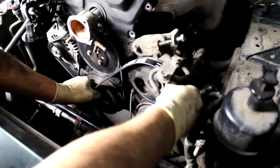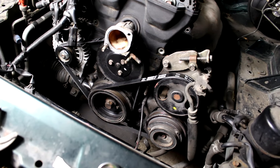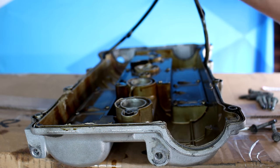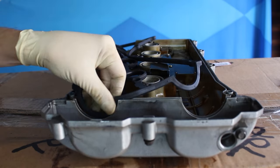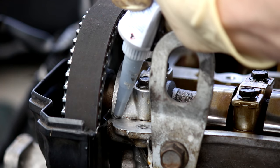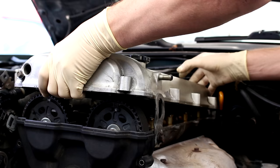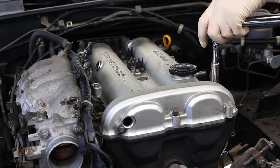Put your power steering belt on and reassemble that tensioner in reverse order. Look at this thing coming together — the whole front of the engine is pretty much done. Next up is the valve cover gasket. I don't know who decided to RTV this entire gasket on, but I really don't recommend it — you've got to clean all this out if that's the case on your car. I do not use any RTV on the valve cover gasket except on the cam caps. There are six different locations where you need to put RTV to stop oil from leaking. Drop that valve cover back on and tighten up those bolts in sequence to 75 inch-pounds.